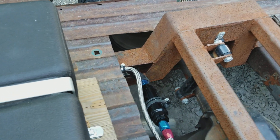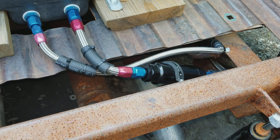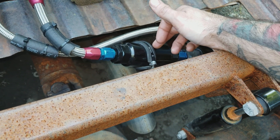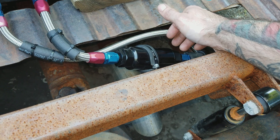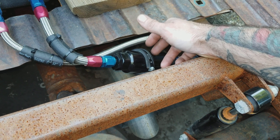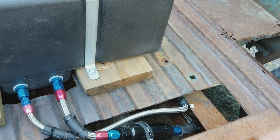I'm just baffled. So once again, if anybody has any suggestions — I'm still having fuel problems. This is a brand new fuel pump. The only thing I can think is maybe it has a manufacturing defect that it's not letting enough fuel through. But I don't understand why it lets enough fuel through in the beginning, and then as soon as the temperature starts to get up, you hear that whining. I mean, I was at 100 degrees and it was starting already.